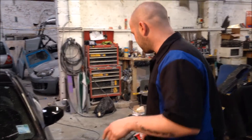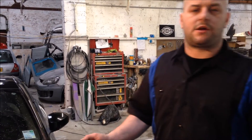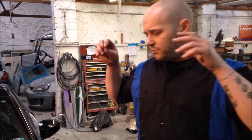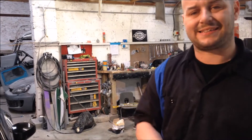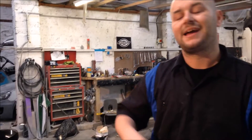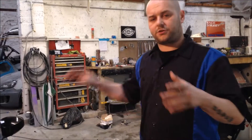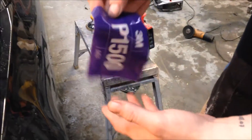When I'm colour sanding and buffing, I like to do quite a coarse grit first off. The reason being is with stuff like this, you're refining the surface. If you were just using it to get crap out of the paint, you'd probably go straight to a 2000 to de-nib and polish. We go in by hand — we'll go straight in with 1200 grit. The first initial cut is a sharp, short grit that slides straight across, taking it down. If you went to 1500 or 2000, you're not really going to be taking down the roughness, you're just kind of fumbling over it. We're using the 3M paper, the 3M soft block — the 1500s are the new Velcro ones, which are unbelievable, they are so good.